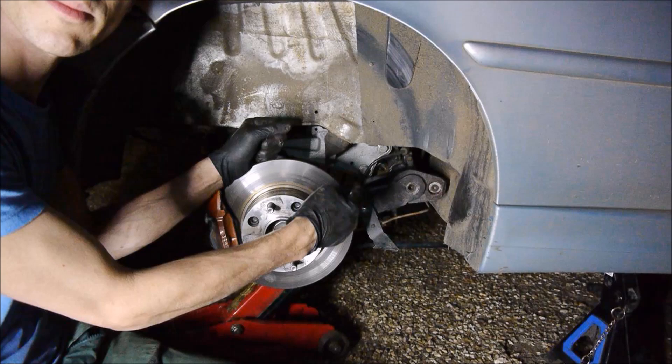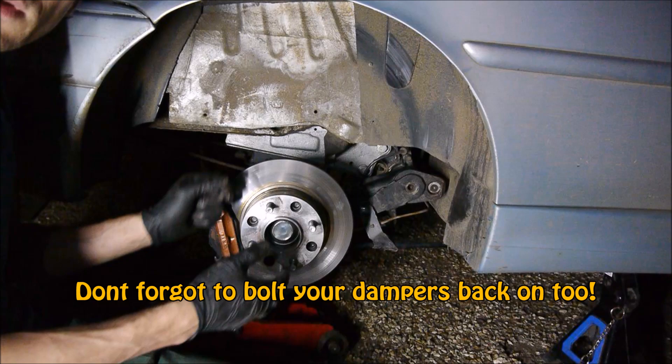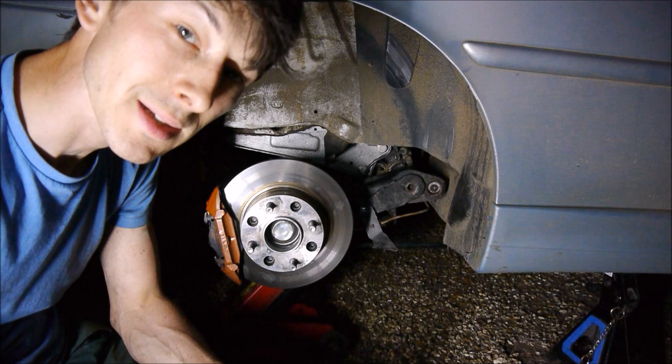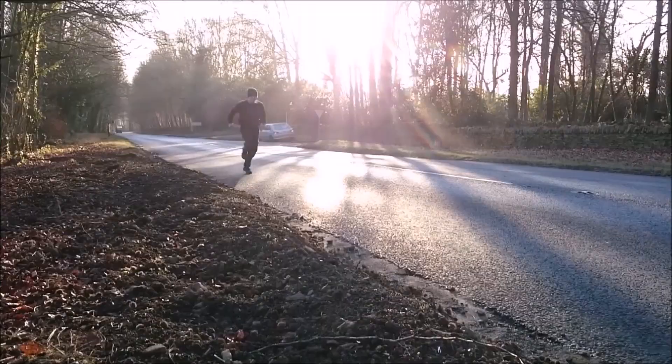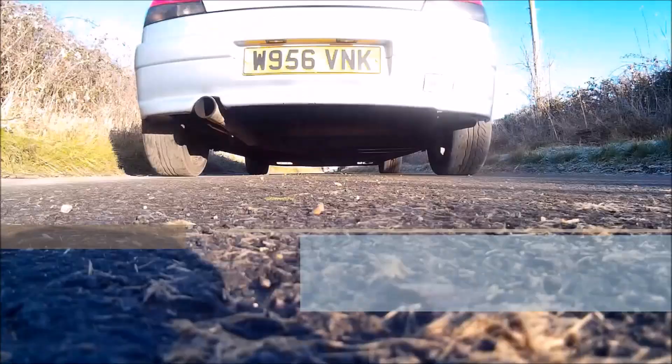Repeat the process on the other side: take the torsion bar out, adjust the hub to the height you need, then put the torsion bar back in, rotating it to get the splines lined up, tap it home, and grease it all up. If you're lacking seals, stick a bit of RTV on it to keep moisture out. Bolt it all back together, pop your wheels on, drop it back on the floor, and feel happy at your new ride height. Thank you very much, I hope that's been helpful — give it a thumbs up and follow Piggy Power Official on Facebook.